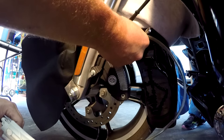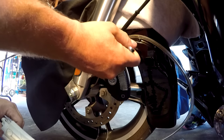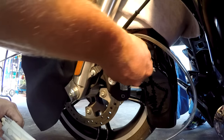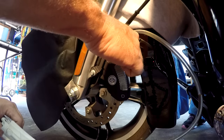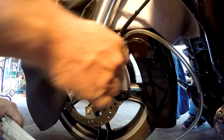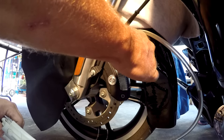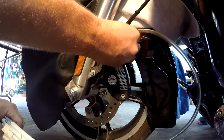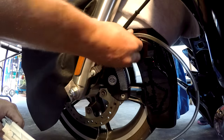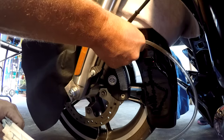It's clear now coming out. So we're going to put a wrench back onto the bleeder valve and tighten it with pressure still on from the bleed tool, so we don't want any air going back up in the line. Since it's still pressurized, when we pull this off it'll suck the fluid back down into the reservoir and we won't have any mess.